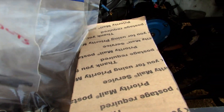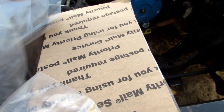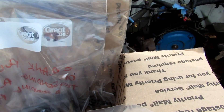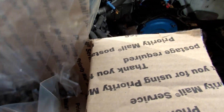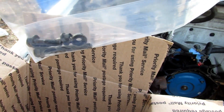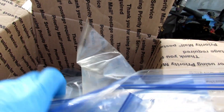When you take an engine apart, get yourself a bunch of bags — these were like 80 of them for about $12 at Walmart. I go ahead and mark what they are so I don't lose track. That's my old pump shaft. I'll put these all in the ultrasonic cleaner. I've got a few oddball things — I think that's the harmonic balancer bolt and the oil pressure sending unit, all my pan bolts. I keep all this stuff together. Those are bolts for the rear main seal. Well, that's the update on this one — until I see you next time, y'all have a good one.